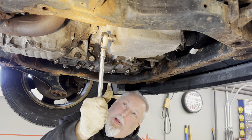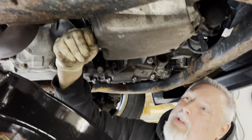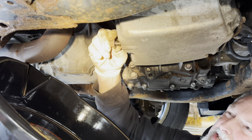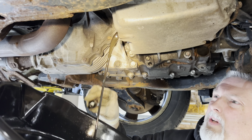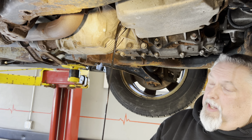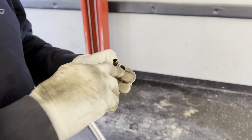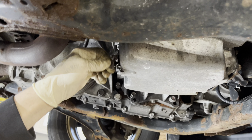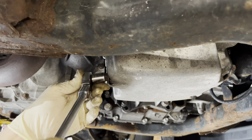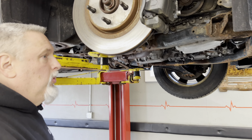We've got a 15-millimeter socket on the oil pan drain plug. Looking at what came out of the oil filter, we're a little scared to see what's going to come out here — I'm hoping liquid comes out. And we really didn't see a lot of oil coming out of this thing. Maybe two and a half quarts if we're lucky. We checked the gasket — the gasket's good, not torn or anything. We'll sit the drain plug back in and snug it up, then wipe it down.